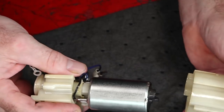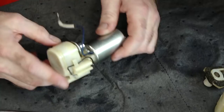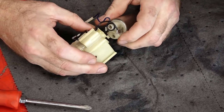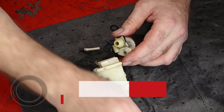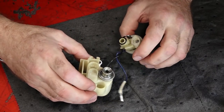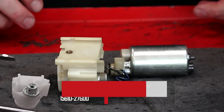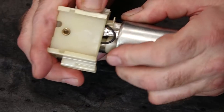Let's go ahead and split this apart and see if we need that filter to come off. What you're looking at here is the actual fuel pump motor itself, and this part here is the pressure regulator. We want to pull that back and take a look at our o-ring. Ours look to be okay, but they are so inexpensive I'm going to go ahead and replace that one. Quick note: if yours was reading too high or too low, it could have been this regulator was stopped up — we do offer that separately, so instead of replacing the entire assembly you may want to go for that first. But ours I believe was caused by the pickup filter. So let's go ahead and start putting it back together.